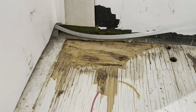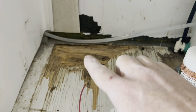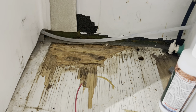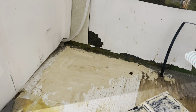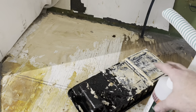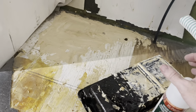I've scraped out from underneath the water here as much of the rotted wood as I could, down to the driest, cleanest under piece. I'm probably leaving very little left — maybe a quarter of an inch of wood — but that's okay because that's just what I need. That stuff used a lot more than I thought. Hard as a rock after I added the petrifier. Once you petrify and leave it for 24 to 48 hours — I gave it about 36.